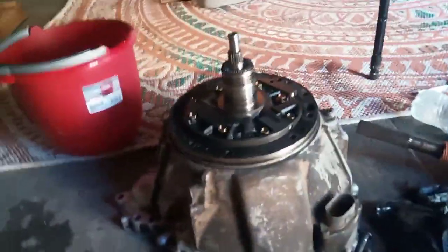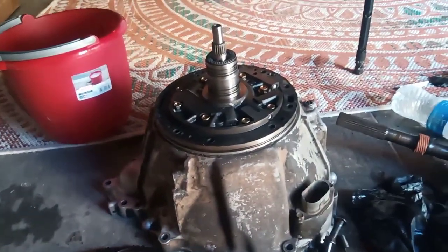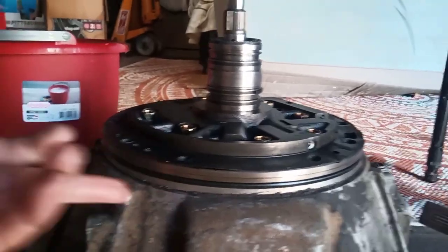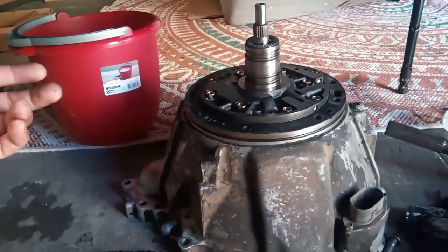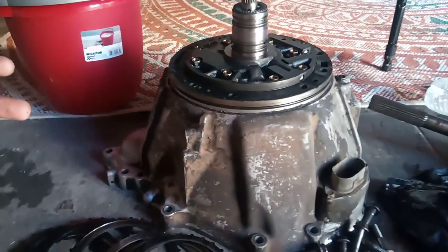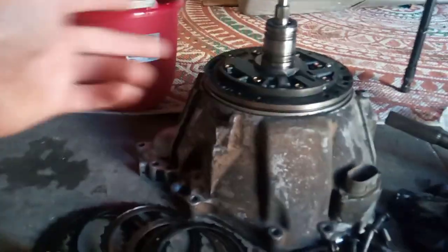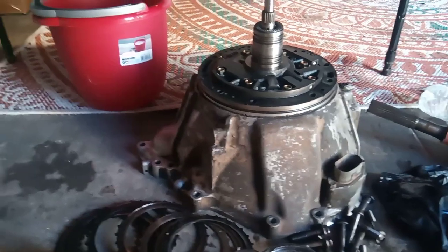This is from my four-wheel drive transmission. As you can see, the oil pump is gasketed to the bell housing, so I couldn't get that out. I ended up using the oil pump and bell housing from the two-wheel drive transmission on the four-wheel drive transmission. I just went back and forth between the two transmissions to see what fit — basically making one big Frankenstein.